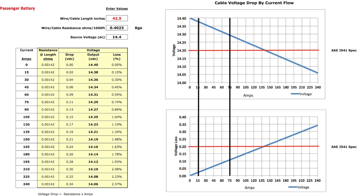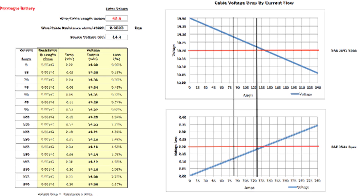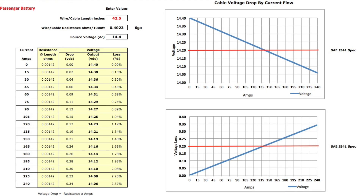If we look at the typical operating current use of pickups — 16 amps of engine controls to 75 amps of all electrics on — it performs in spec, with a voltage drop of one-tenth of a volt. Being enthusiasts, we're going to examine what happens outside of the average. The 140-amp alternator generated this at idle. Adding a small pulley generated this, and at elevated RPM, this — that's snowplow territory. So even with a stock alternator, there's room for improvement. When we see lower voltage with high electrical demand, it's not always that the alternator can't keep up; resistance in the wires and connections has an impact.